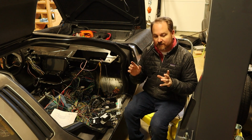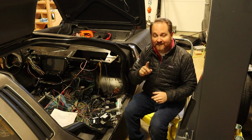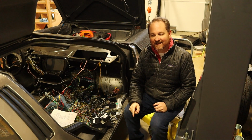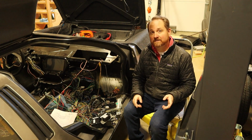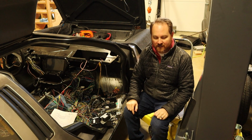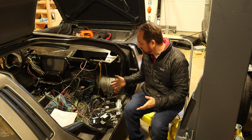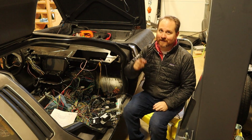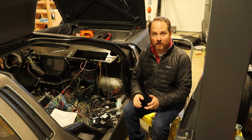I found that the 2019 Chevy Bolt that I have does not have a front-facing camera module, but it's an option in other vehicles. And that option uses the CAN bus. And I didn't think that that would matter, but it does. So I had not plugged in the headliner circuit, and the headliner circuit itself has a bridge for the CAN bus. So now what I am going to do is try and go through this mess of wires and actually find the headliner harness connector, wherever it is, somewhere I haven't been able to find it. Once I find that, I will plug in. It's literally just a harness that has a loop in it. And hopefully that brings a conclusion to these last 3 days of diagnosing this problem.